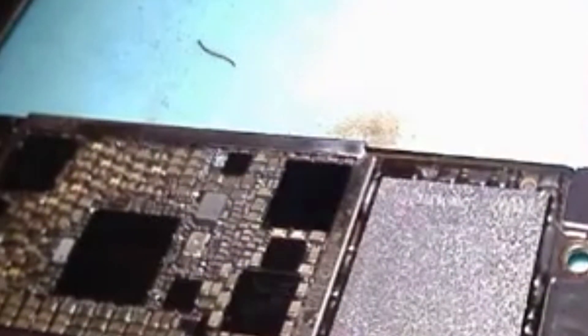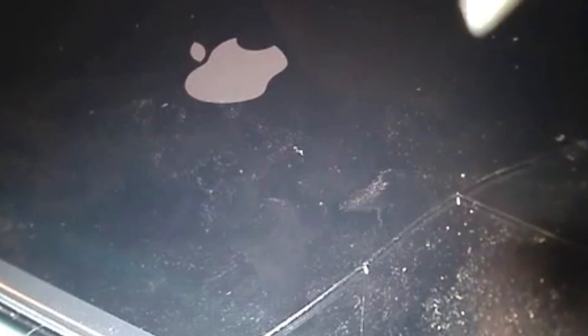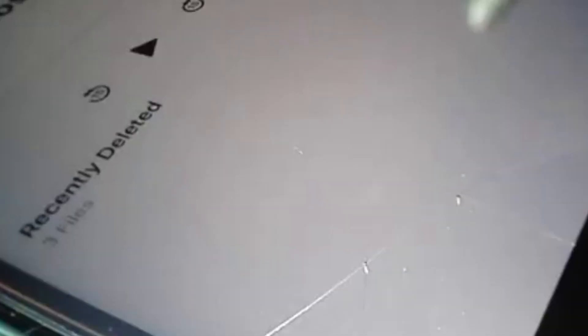It's just attacking these new boards. So now that our inspection has passed, we're going to come back in with isopropyl alcohol and a toothbrush and just clean off the major flux from this board. Afterwards, this is going to go into an ultrasonic cleaner where it's going to be cleaned thoroughly. Here's our little testing procedure for audio IC disease — this is a broken but known working screen and a known good back housing. That way we can rule out everything except for this motherboard. We're going to see this boot time — before the disease it would be about five minutes; without it you want somewhere around 10 to 30 seconds. So that came up very quickly — it seems like our problem is going to be resolved. We're going to open voice memos, and it opens properly and we can actually record ourselves. We see that nice waveform.